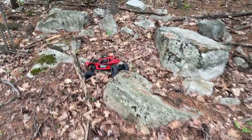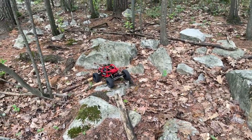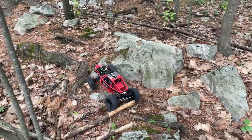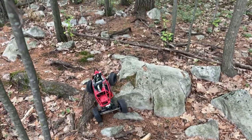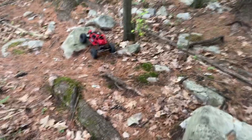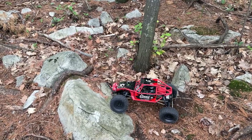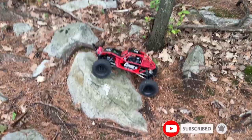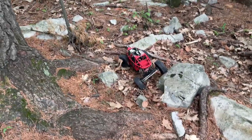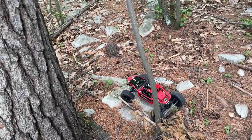But if you're looking for a smaller vehicle with tons of options — four-wheel steer, and you could even do the dig on it if you wanted to. You would need to open the transmission and install the components, which is doable and not expensive. The remote doesn't have another channel available because the third channel is already used for four-wheel steer, but if you upgrade to a Spektrum DX5 or DX6, you'll be able to do it. Same as my RR10 — I have a DX5 Pro with dig and four-wheel steer. This Capra might get a DX5C or even a DX5 Pro as well.